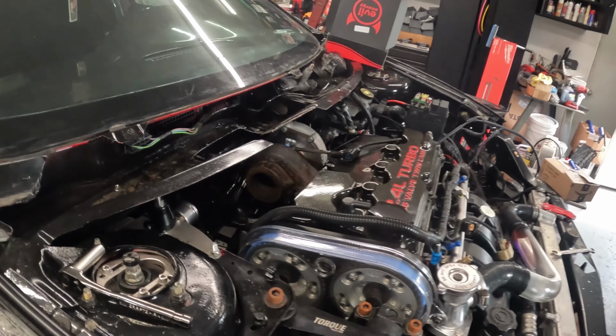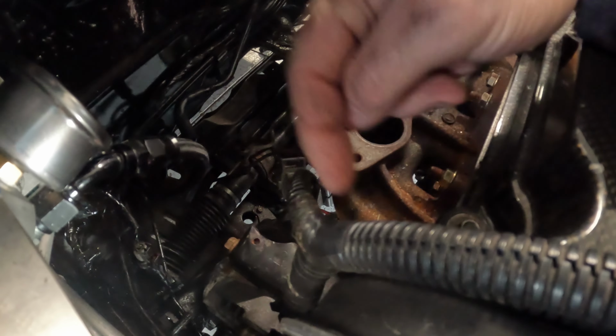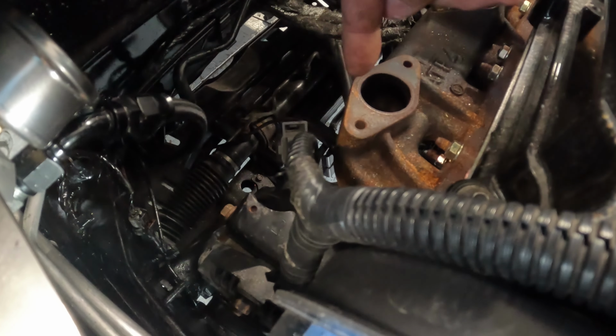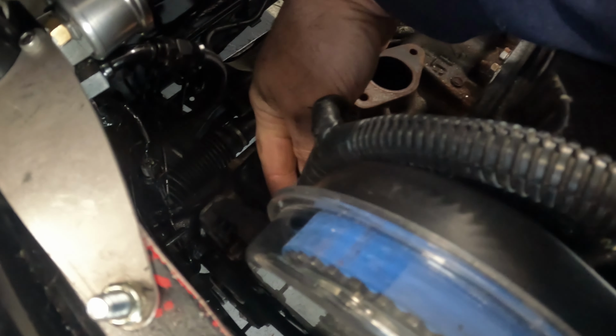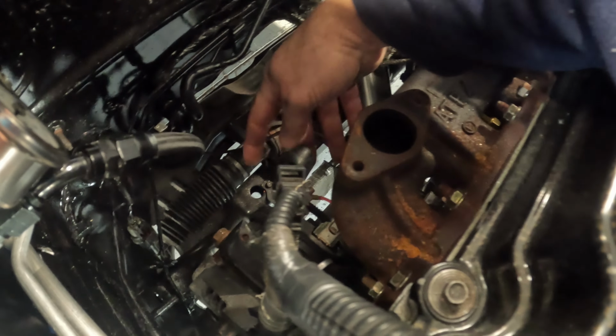So, all right, we're working on getting some stuff figured out here. We had the wire routed. I had to loosen everything up here on the alternator, but we have the wire routed down. It actually goes between the alternator down here, behind the alternator, and then wraps out around and comes out from the bottom. So I have that installed, and I also brought the power wire for the fuel pump relay up through this plastic so that this can get inserted. I got to double check the tightness on that.